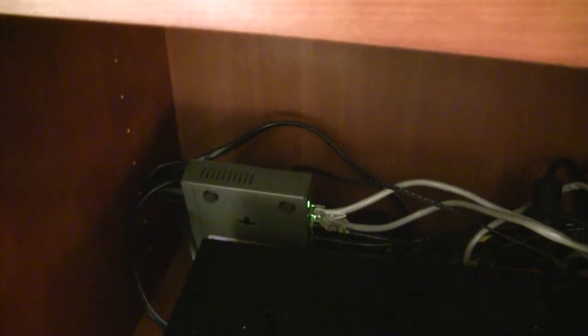And then for our Blu-ray player, we've got it in this cabinet here, and behind that I've got an Ethernet switch. So I ran hardwired. I think wireless is fine, but if you really want performance, you want hardwired Ethernet. I ran some wires under the house about 8 years ago, when I got the first TV, from our cable modem over to here, and then I have a high-speed switch here. So the Blu-ray player is on the internet, Ethernet, and the TV, of course, is on it. And the new receiver will be on it.